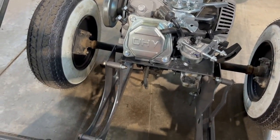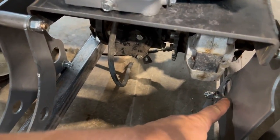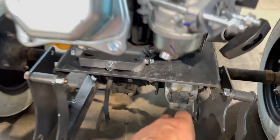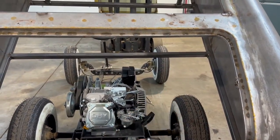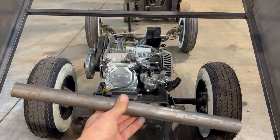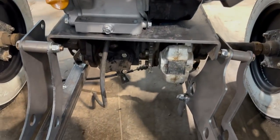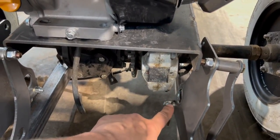That's okay, it's a little snug, but that's okay. The problem I'm having is that I put a hole, which you can see here and there, to have my cross member come across. That is the strong tube that our tabs will be off of for the gas shock and the linear actuator. That's this tube right here. Now, here's the problem. This tube, where those holes are, runs right into the brake caliper, which is right here. So that tube interferes with that right there.